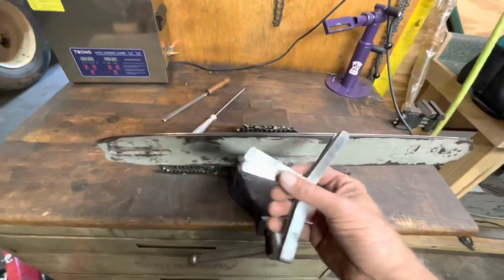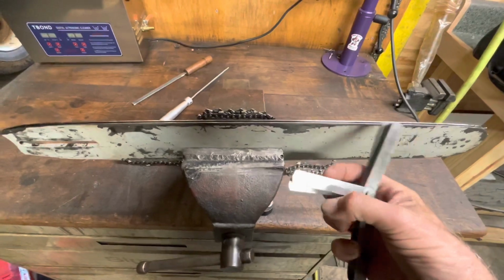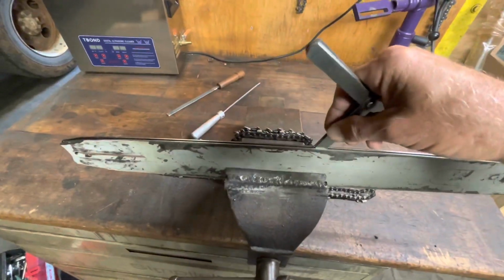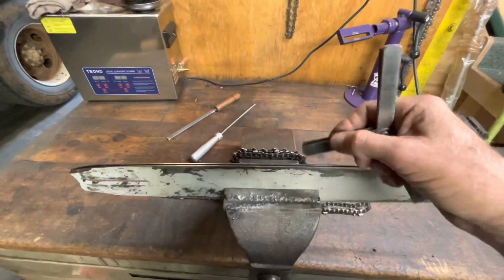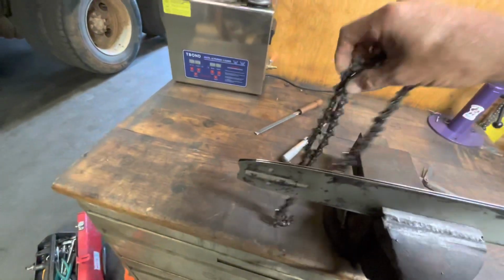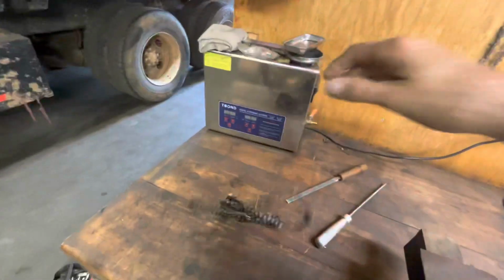All right, first thing, just want to make sure we're not too far out of whack. I've stacked up some feeler gauges. This adds up to 53 thousandths, and it's nice and snug in there. This is supposed to be a 50 thousandths groove. A few thousandths won't really matter one way or the other. And if I can lay this up here, I need both hands now.